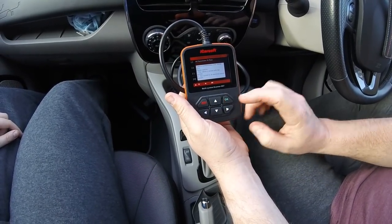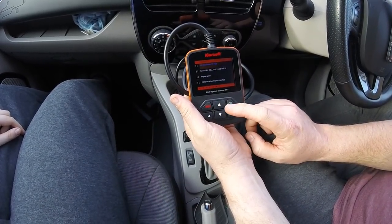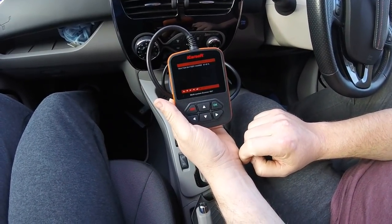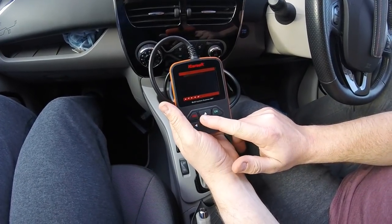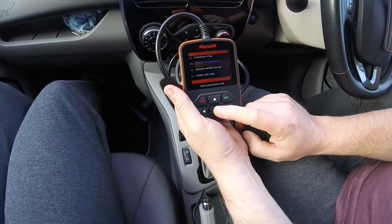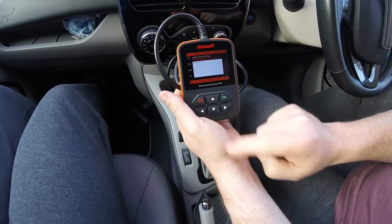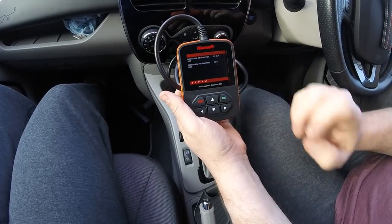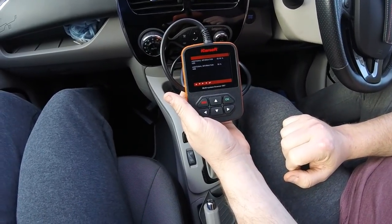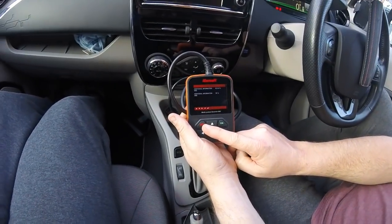I fail to communicate with ECU — that's because I'm not powered on. Let's try again. And traction battery charge — there we go — 81.49% on that one. Now if I go along, additional information: 14.05. And then I'm going to click 14.06 as well, so we've got two highlighted. Let's escape. And we've got 98% state of health and I'm 82.85% charged. That's the big one that everyone wants to see.